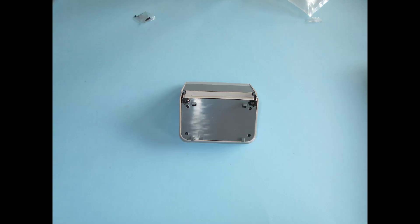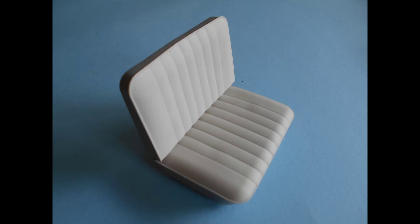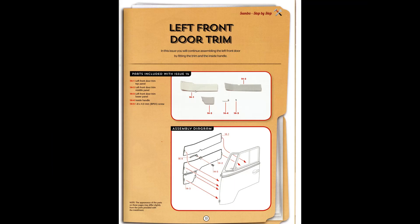There's a little bit of a trick here. You need to push the seat back brackets fully into the depressions in the bottom of the lower cushion to seat them all the way in, then screw those into position in the holes provided. Keep the bottom of the seat back on top of the lower cushion to make sure it doesn't bind. You can see here the completed right front seat — it's very attractive, looks just like the original with some soft vinyl and great texture.